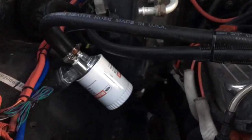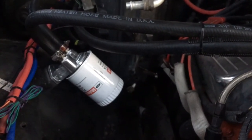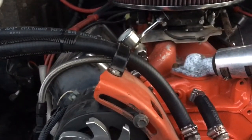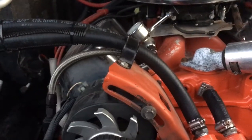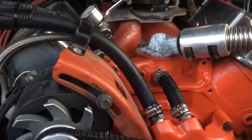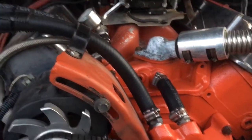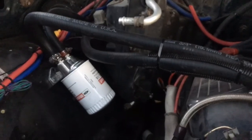So this has been a pretty good upgrade. I'm going to change this filter here pretty soon — run it for a few hundred miles and change it out — and hopefully that takes care of all the debris. The reason I want to install this is that on my Power Stroke I've got a coolant filter. If you have debris in the system and the water pump is spinning it up, that is eating away at all your gasket material, all your silicone, anything you have set in place like the intake manifold. Eventually that's going to erode stuff away — it's just like fine sand or fine material in there eroding things. By installing this, I can increase the life of my gaskets. If you guys have any comments or questions, let me know. Talk to you later.